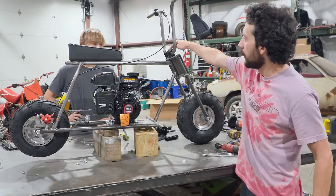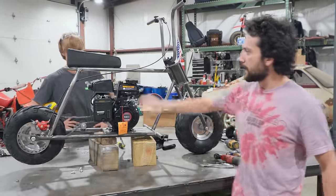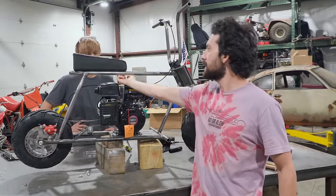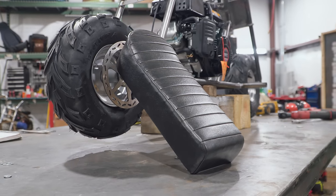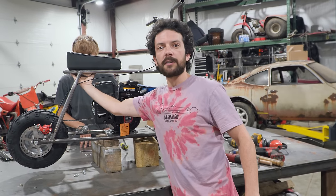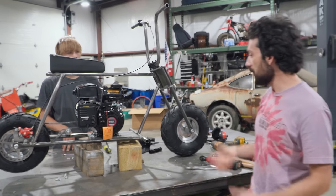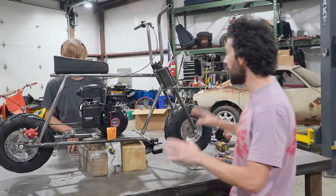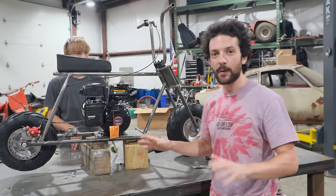One being we had to drill out the holes for our handlebar clamps, no big deal. The second is that only one of the seat bolts lines up, so you can either buy a different seat that comes on the regular Rascal in addition to this kit, I'll link one in the description, or you can make something work by welding something on the frame to make the seat fit. Other than that, it's good to go. I mean, $500 gets you a running and riding mini bike. So now that it's passed our assembly test, we can take it all apart, brake clean it, and get to painting.